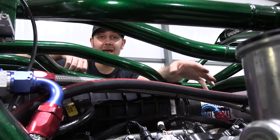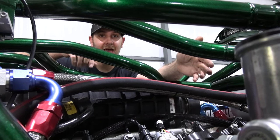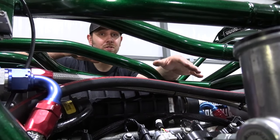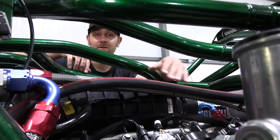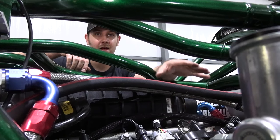Our kit comes with dash 8 fittings, same thing as a half inch JIC. Make sure that when you plumb the system, you're running at least that size line. Do not put a smaller line on that Hydroboost unit.